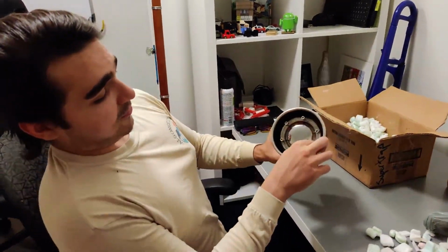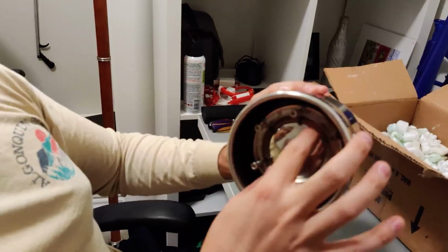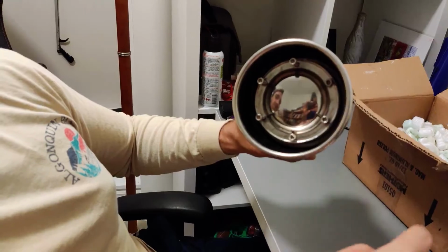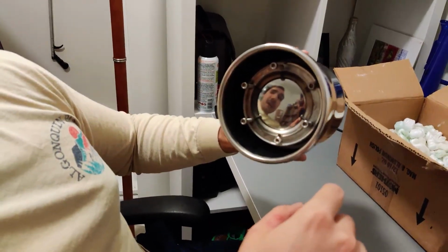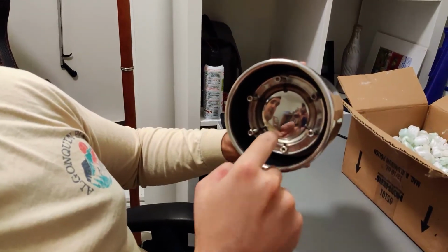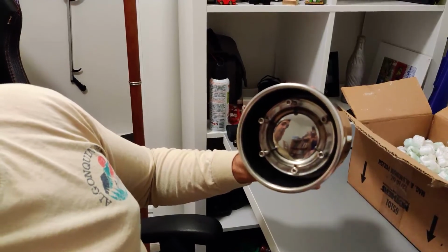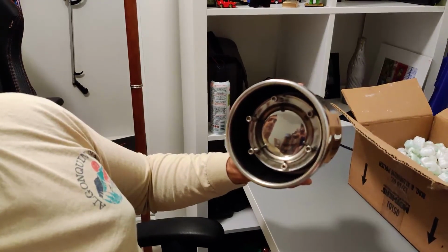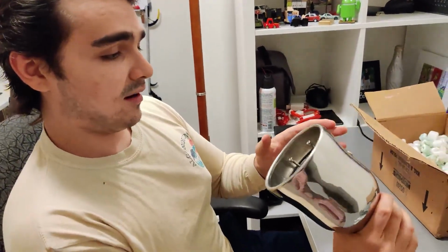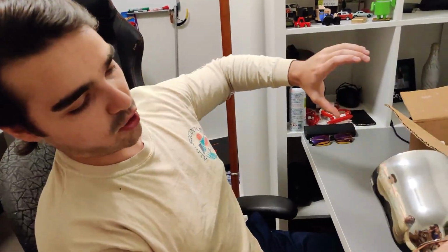So to explain the Supertrapp a little bit more, you actually have these baffle plates here. This is a unique baffle plate on the end that's fully enclosed, and there's a bunch of baffles down in here, and each one of those is actually kind of semi-open. And so, weirdly enough, if you put all the baffles in here, it's about medium loud. If you take them all out, of course, it's the loudest. And if you put like half of them in, it's the quietest. Because physics and stuff. Pretty commonplace on bikes and even sometimes trucks. A lot of times you'll see them more elongated and longer.